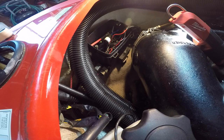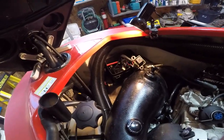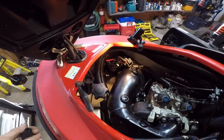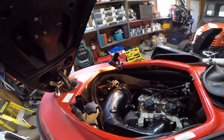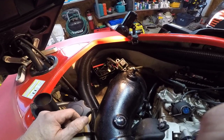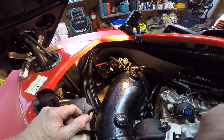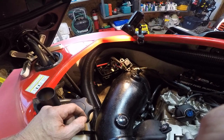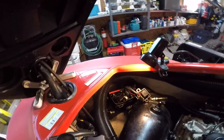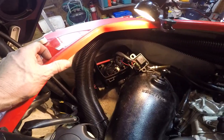All right. So now, hook the power back on the battery again. Alrighty, so that's in. Check the power, still 8.5 volts. When I put the tether on, you can just hear every once in a while a little bit of noise. Whether it's the fuel pump trying to pump, but just not quite enough power there. So we gotta trace the power and figure out why it's 8 and not 12. There's something somewhere, fuse blown somewhere, something, and we've just gotta trace it all out.